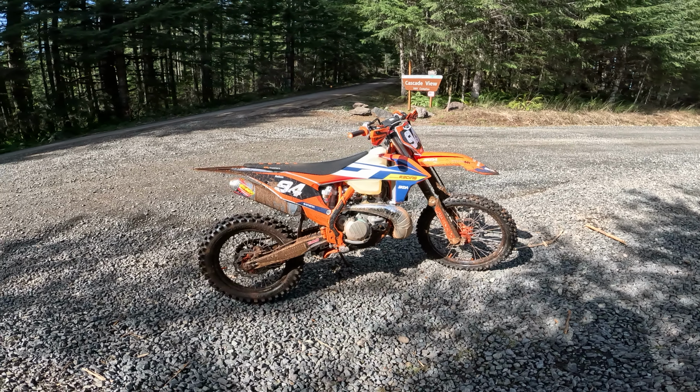So you've got a titanium bolt up front and you've got billet aluminum motor mounts up top. And the biggest reason that I did that, now I've done it on my other bikes too, but on this model, and I know the 23 is a little stiffer, so it'll be a little bit different, but there were tendencies where I would come into a corner and lean the bike over and it didn't want to come back up. And I had that same issue with my 2019 model. And so I did the same thing. I put the FCP motor mounts on there and that eliminated that issue.